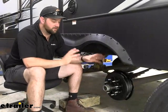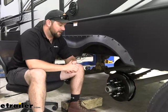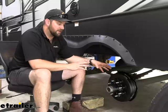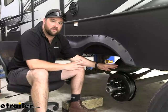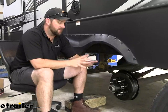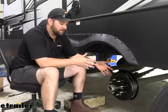If you're looking into changing out your brake pads or repacking your bearings, anything like that — the thing that is the most confusing and scary about electric drum brakes is that because the drum covers the brake pads up, you have no idea what you're getting yourself into when you take that drum off. I've taken drums off of electric brake setups before and the pads literally fell off. So I definitely recommend being over prepared for whatever you're getting into.